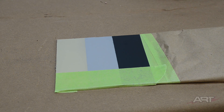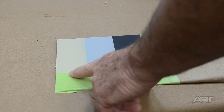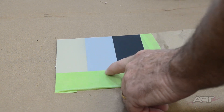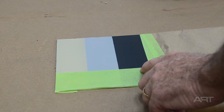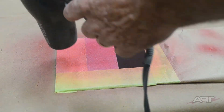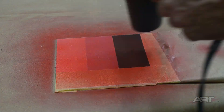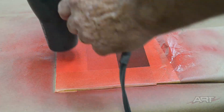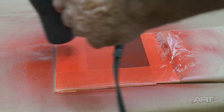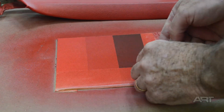Enhancing the already red but faded panels is no problem. But what about those black sun visors? To illustrate the dilemma we face, I have prepared a mock-up here. From leftover leather dye, I've selected two colors that could be used as primer colors: a light yellow beige and a light gray. The black will represent our new visors. I'm going to give equal coverage to all three of these bases — a few light coats at first and then a couple heavy coats. It's easy to see that our primer color has a great impact on our target color.